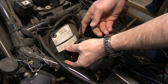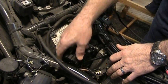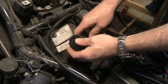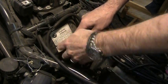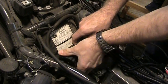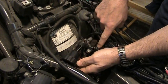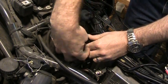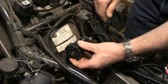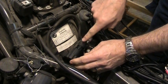Continuing on with our performance enhancements, another one you're going to want to check out is the rear shock adjuster preload. To check that it's functioning properly, wind it all the way out. If you feel it freewheeling — even before it hits the standard marks on here — you might already be set really light. I don't know where the oil goes inside these, but they need to be refilled every once in a while. If you can freewheel it around with no resistance until way down here, that's pretty bad. It gets all the way down past the standard position before I can feel resistance. So we're going to have to take all this apart and refill it with oil.